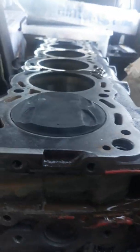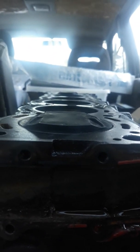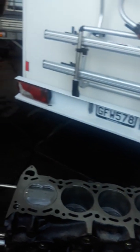This is a 25DE block — as you can see, the pistons protrude from the block quite a large amount. Compare it to the RB30 pistons, they don't protrude much at all. So hopefully that will yield an ideal compression ratio for turbocharging it.